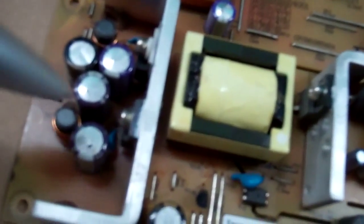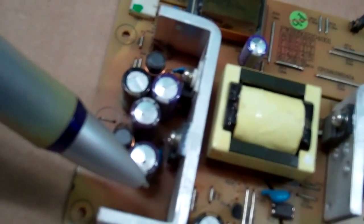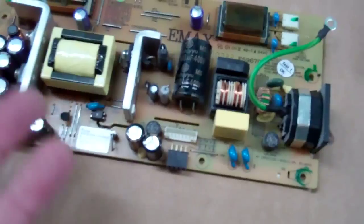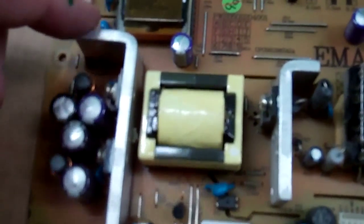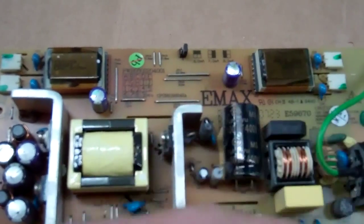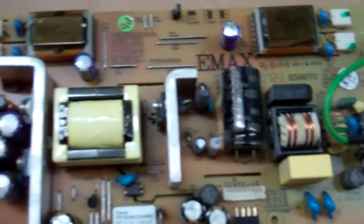Then we come to the low voltage side, which has two different rectifiers and maybe regulators. They use one chip for everything with a couple of capacitors, providing five volts and 12 volts. This is the high voltage section - you can see big holes in the circuit board separating it, with no traces crossing that boundary. The only connections cross here through this chip and capacitor. The inverter circuits are two DC-to-DC converters that take 12 volts and step it up to a much higher voltage used by the CFL backlights, with four plugs.